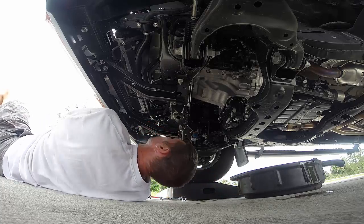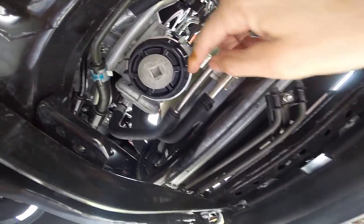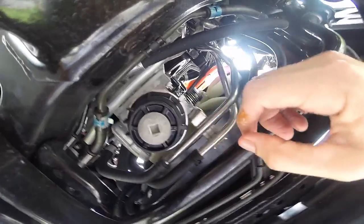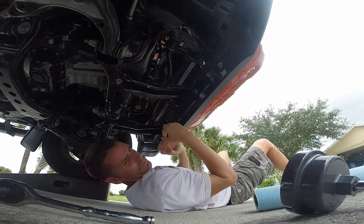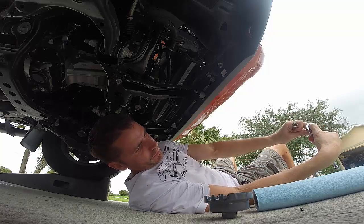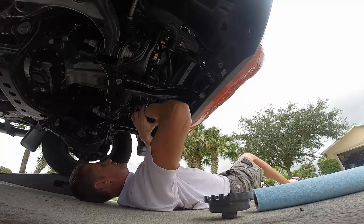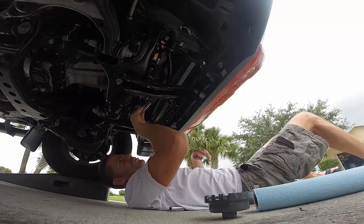All right, so looking at this oil filter canister, got this little catch here. I think it somehow must interact with this when you loosen it, so I'm going to see how this comes out. Let's see what happens. I'm not sure how well you'll be able to see it on the camera. It has just like a 3/8 looking socket extension thing on the bottom. So I'm curious if I put that in there. Oh, okay. If I put that in there and loosen it, it's loose.